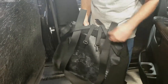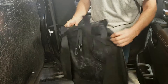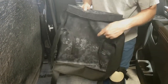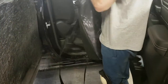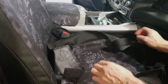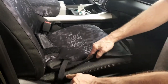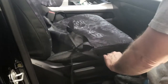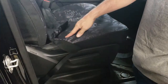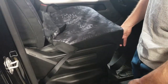We're going to install the passenger bottom. First, disconnect these Velcros. These buckles are going to be hooked to the back of the seat and will fasten the back edge of the seat cover, keeping it from swirling around. Take those off and set them behind the seat. The long Velcro strap goes to the front, and the fuzzy strip goes to the back. We have an elastic to replace the one we just removed. Use extra caution when reaching your hands underneath the seat to route these Velcros — everything under the seat has grease on it and every metal edge is really sharp.